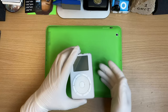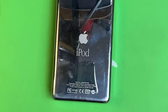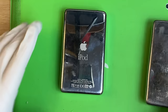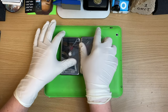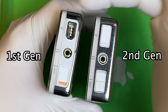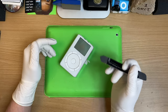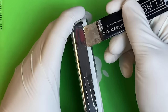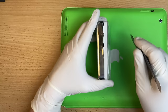The first gen. How do you tell it's a first gen? The middle spins, and there's that font — it's got that smack of late 90s right there. The second gen, which is basically the 1S if you ask me, adopted the font they're still using on the iPhone today. To open it, there are hooks — you want the tool to go in flat. You don't just want to stick it in and reef upwards. You only need to do one side and then it'll all just slide out.